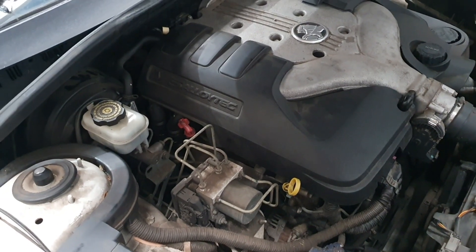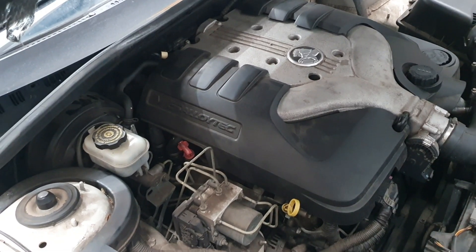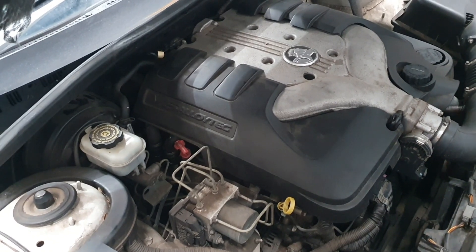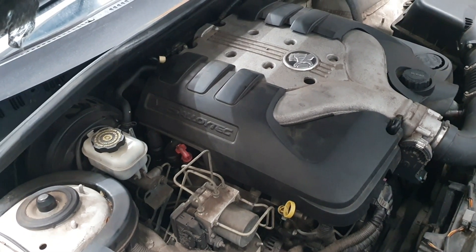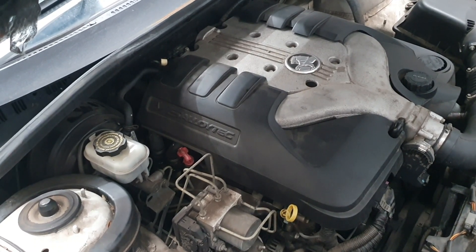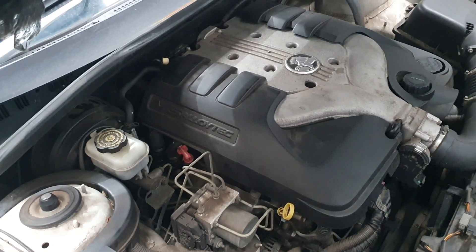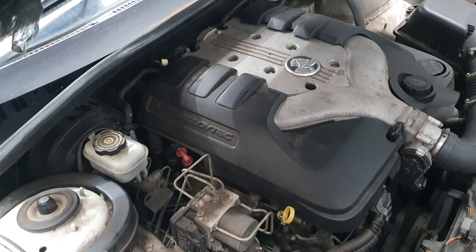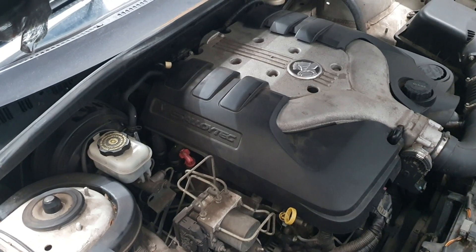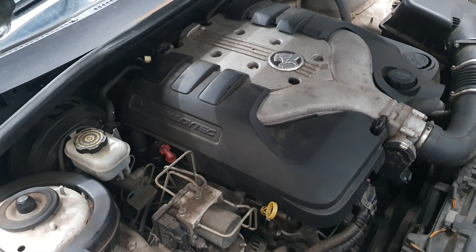Beauty — we are completely running now. Going to go for a drive and make sure it's 100%. The thing I failed to mention is this car has 220,000 kilometres on it, so we recommended a set of injectors anyway — they've never been replaced, and an injector that's partially failing and drawing too much current may cause a driver failure in the PCM. So since they're spending the money on a new computer, we put a set of injectors in and did it all in one hit.